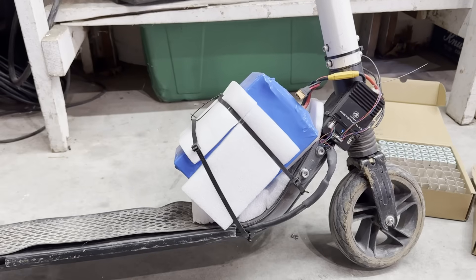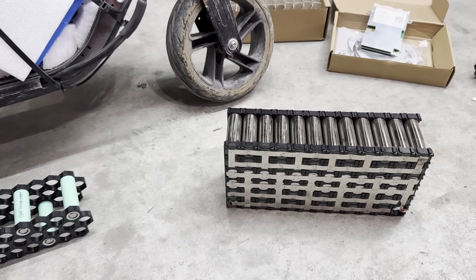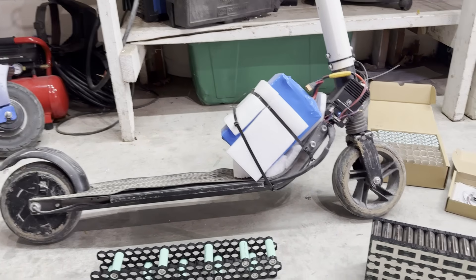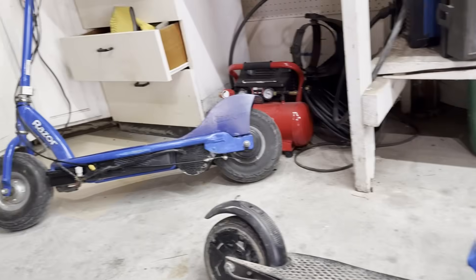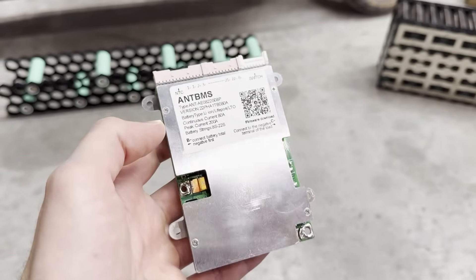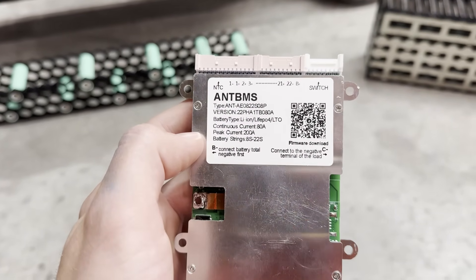After I built this battery, I realized I had this scooter with no battery, so I slapped the battery on it. Now, this battery does work fine, but it's only about 20 amp discharge because these cells are only 3.7 amp discharge each, so that makes this scooter only 1500 watts. That's only 3 times the stock power — I need at least 5 times. So I'm going to be building a new battery with these 2 amp hour, 30 amp discharge cells and a new BMS. This BMS is way more current than I need for this build, but I've heard these BMSs are super tunable, so I should be able to turn the current down to whatever I want.